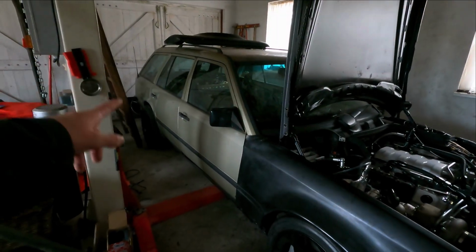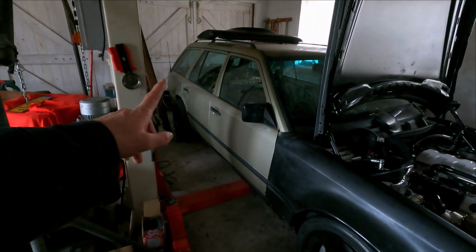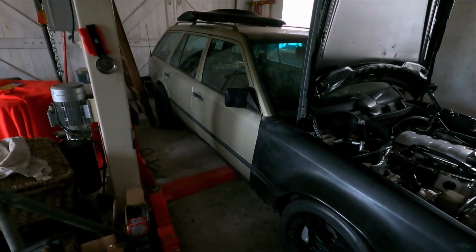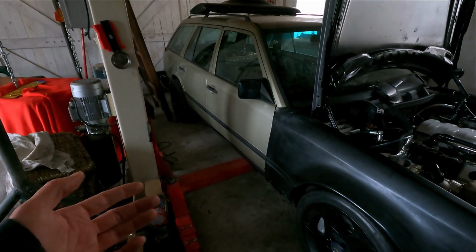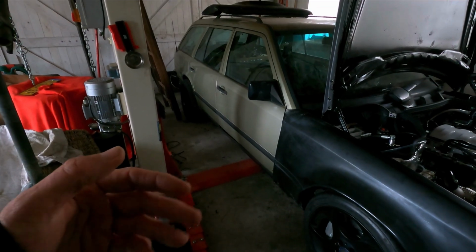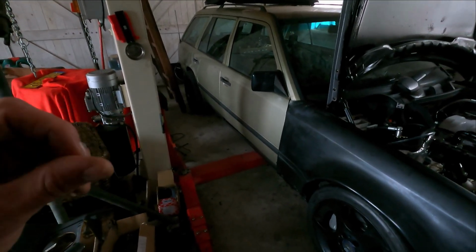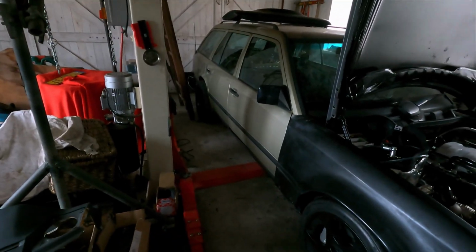Also what I did is, in the back I had a small leak on the level valve. I fixed it. It's now a week ago. It's still on this level. It stays on this level, so that's very good. So when this car is on level, when you lose a little bit of oil, it will drop right away. So a small leak, after a week it will just sag away. So I had that in the beginning. It was standing 6 weeks and then it started to sweat a little bit. So I changed some bolts in the level valve in the back and now it's all perfect.